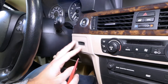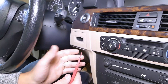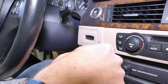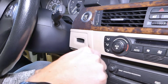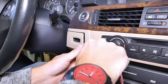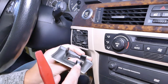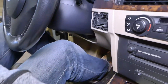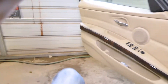You have to be careful because that plastic has three clips, and if you pry too much you can crack it — especially if the car has been exposed to a lot of sunshine. Softly press the plastic panel removal tool here and gently pop it out. One, two, three clips — you can see it comes right out like that.